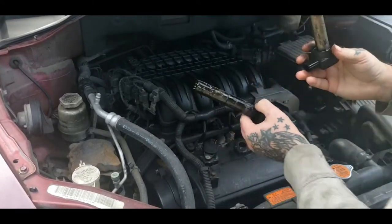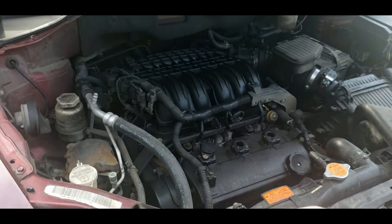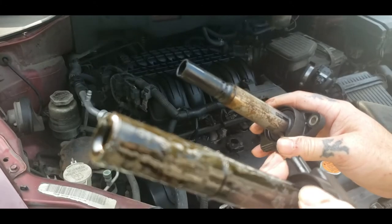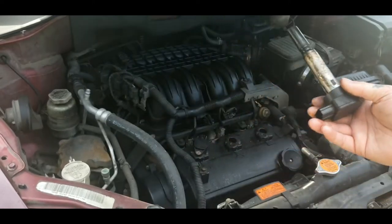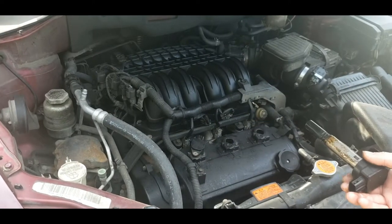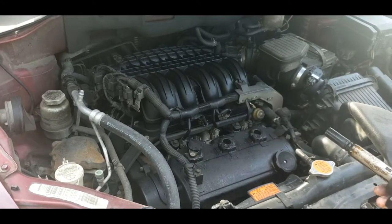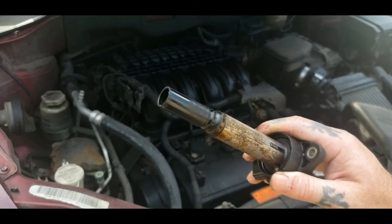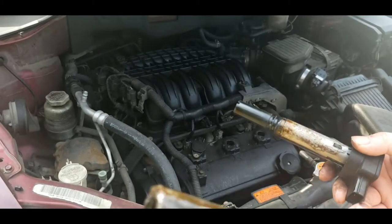they pull straight up. And if you notice, I do got a bad oil leak. This is filled up and my boot stayed on that one, so we gotta fish that out once we get the valve cover off. It's common for that to happen. Don't panic if it does. The boots just flip on and off of these. Quite simple to change them.